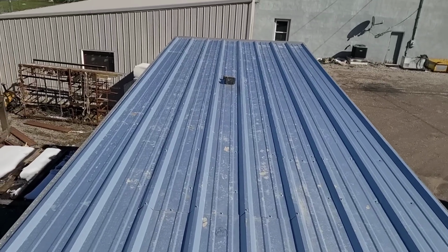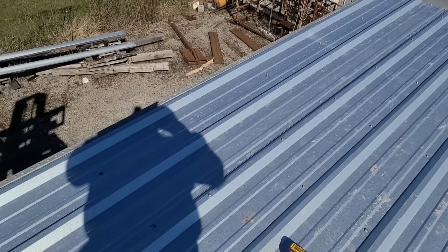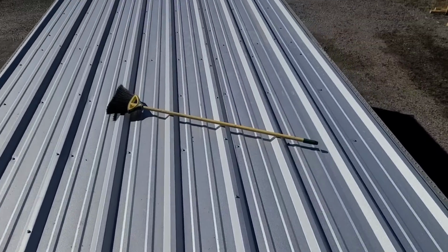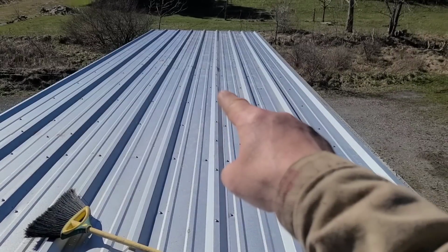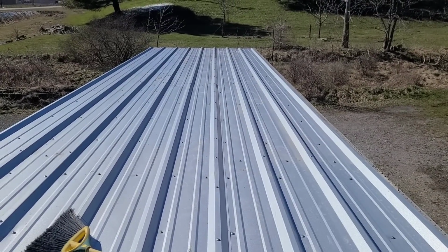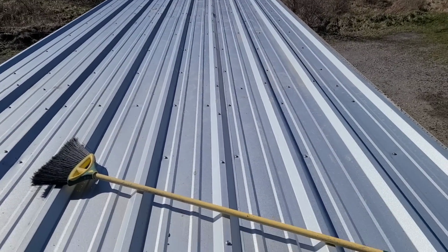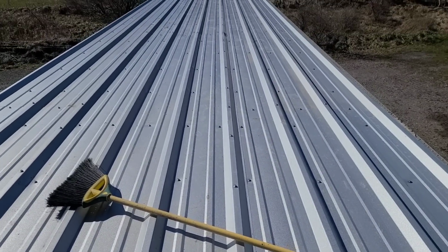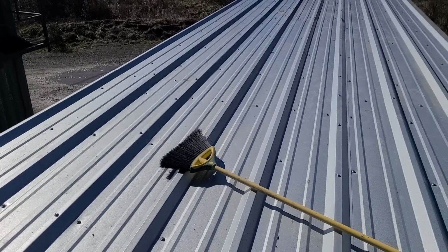That's it for the screws. Pretty much screws every 2 foot except for where that one cross member is missing. And I ran the lap screws everywhere there's a lap, at least every 2 foot. These screws you see down this row right here, that's where there's a lap and the two are screwed together. That'll help keep that from flapping. And the next part will be figuring out those rakers for the sides.